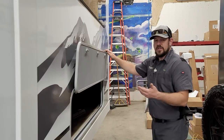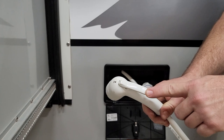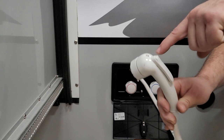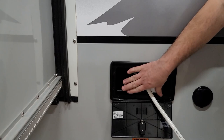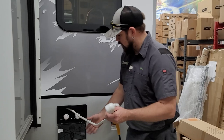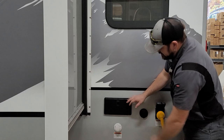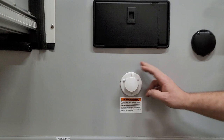Moving just behind the slide, we have the outside shower with hot and cold mixing valves, just like at home. The flow control lever — push it down and water comes out of the head, which locks in place. Push down again to release and shut it off. Remember to turn the water off here when done, as it can cause mixing issues with your hot water. When winterizing, don't forget this area as it's prone to freezing. To store, fish the hose back into the housing and push the spring-loaded latch to close the lid.